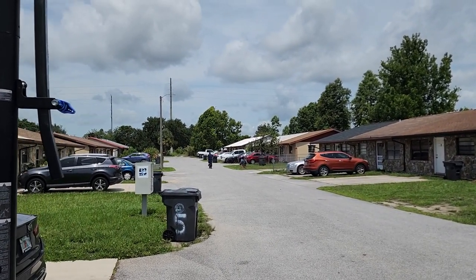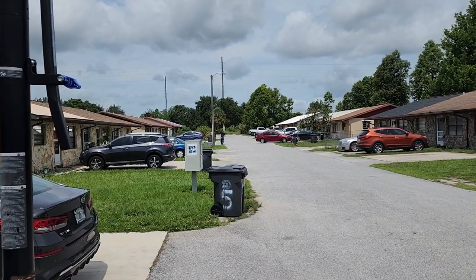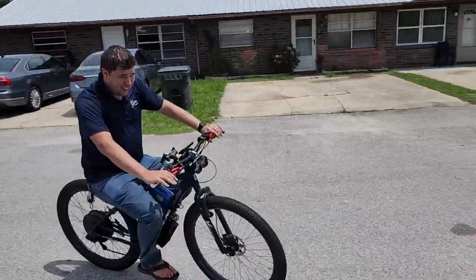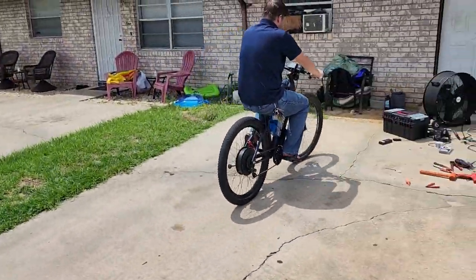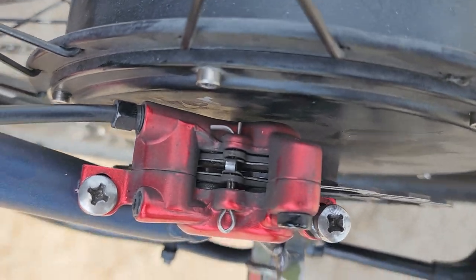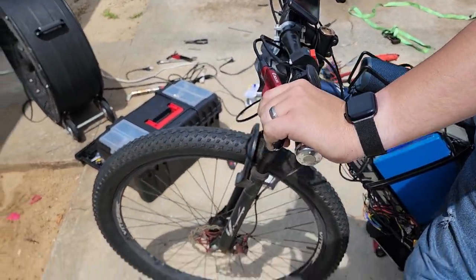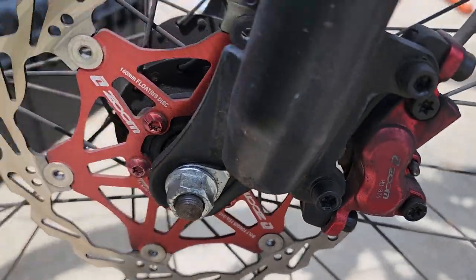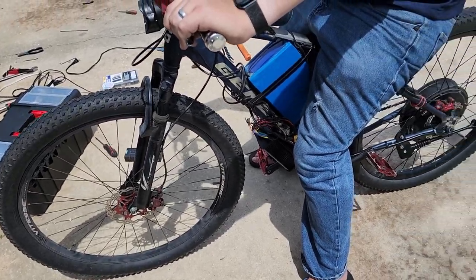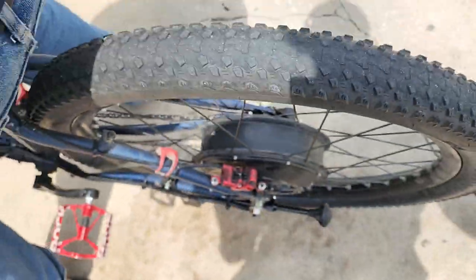Man, I'm glad that worked! I thought we burnt the controller up, but it turns out it was just the phase wires rubbing and cutting. You're going to need some new brake pads though — I noticed the brake pad is getting thin. This one doesn't have regen so he's using more of his mechanical brakes. You'll need to upgrade the controller so you'll have regen braking. Those are brand new calipers and disc brakes, but the pads are about 19 bucks on Amazon and they're really thin — the pistons are almost fully extended.